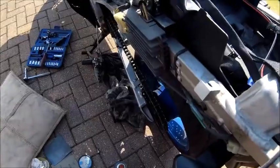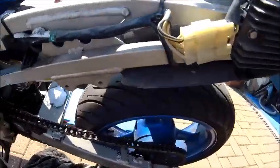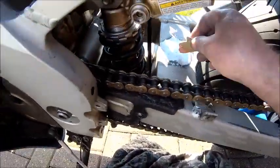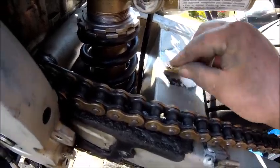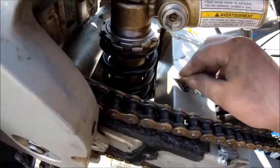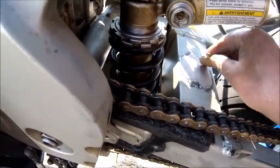Not too bad under here, very dusty, but not too bad. So it looks like the only bit I've really got to tidy up is along there and on the swing arm. I'm not going to take you through the boring stuff — I'm going to get on with it. Just a little something to stop the promotion of rust: a little bit of P40 fiberglass filler over the bit where there was a little bit of pitting going on. That's all we need, just a little covering of that, and that will stop it.